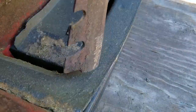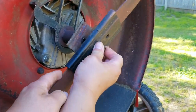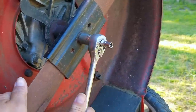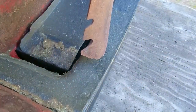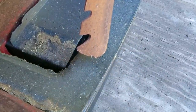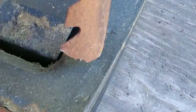If we take a closer look at the ends of the blade, they don't show any real signs of damage. I thought I might try to bend the higher end back into position, but instead I'm going to install a different blade and see if that one was bent too. The reason I'm doing it this way is because I don't want to buy a new blade only to find out that the shaking hasn't gone away. After installing the other blade and doing the same visual test, I can see the ends of this blade are very close to each other. So I'm very confident that if the shaking goes away, then the bent blade was the cause. I'll just mark the old one as bent and set it aside for testing or to be bent back into plane later.